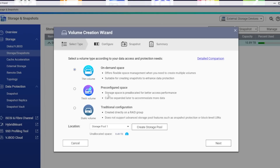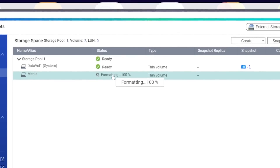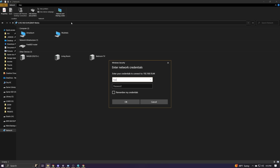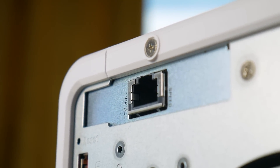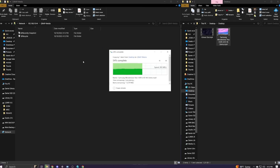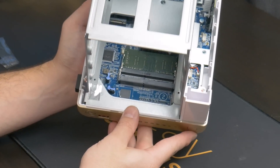I ended up creating a thin volume called Media alongside the existing volume called DataVol1. I eventually got all the basic NAS functions set up and had an SMB share working. I made sure to also set up the 10 gig connection to really put things to the test. Performance was right about what you'd expect for a RAID 5 setup — which is to say barely any faster than what you could get with a 2.5 gig connection.